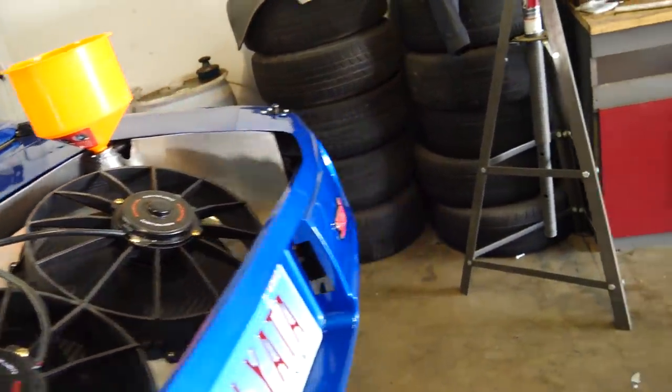Surprised I had some issues bleeding the coolant. See, the problem is that the coolant only bleeds if the external water pump is on, and the ECU only turns the external water pump on if the temp is over 205. And it goes over 205 for like 1 second, and then the fans and the water pump are so powerful, it cools it down so quickly, it doesn't have enough time to push the coolant to all the places where it needs to be.